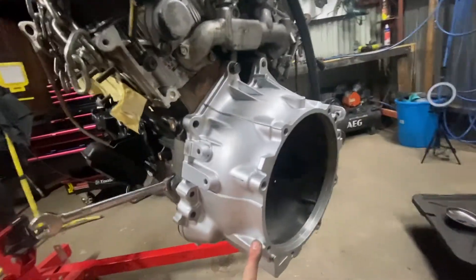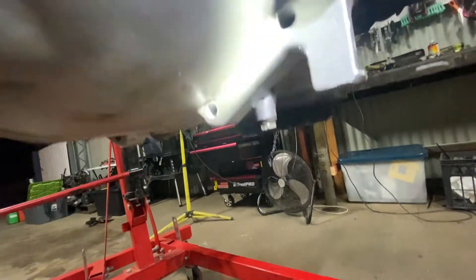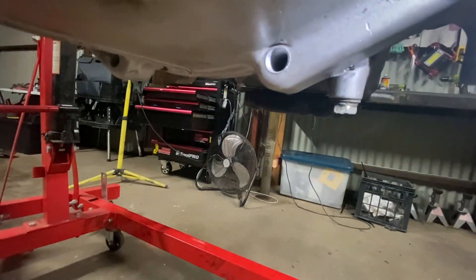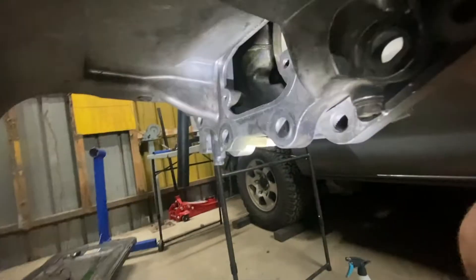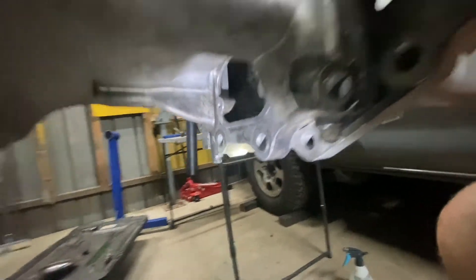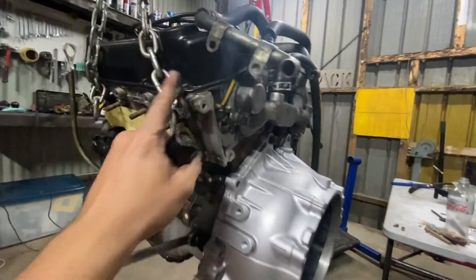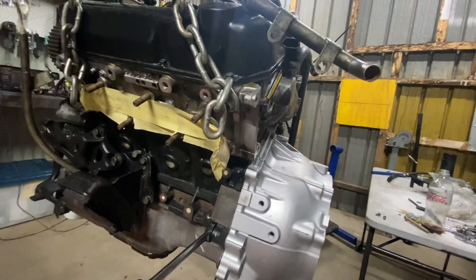Test fit done — she's on. The 380 motor will go on to our original transmission. I've got nice clearance there. I just had to tab that little bit out of the way. This bit was fine. We've just rounded off that part of the head — that bolt head, we just cut it down, and it just clears it. That's precision engineering there, mate. Bob's your uncle. She's on — ready to go in the donk. We'll take the bell housing off, chuck her in, and the last thing to do will be to cut off that section there. And in she goes.